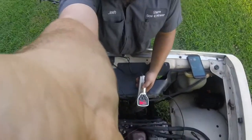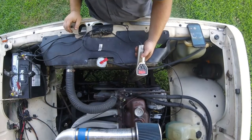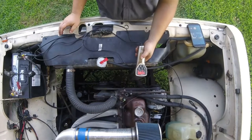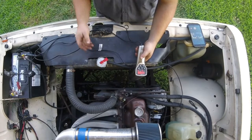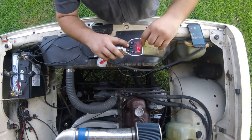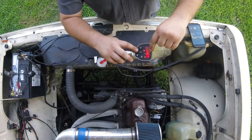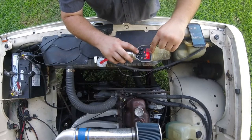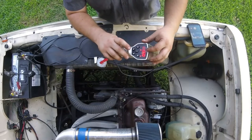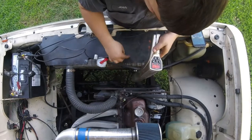It's probably going to be pretty hard to pick up on camera, but there's a white mark on the crank pulley, and it corresponds to about 16 degrees right now on that mark. It goes from 0 to 20 in my case. One thing that's really nice is, say if I wanted to be at 16 degrees — which I do — if you only have a zero mark, what you can do is go ahead and knock the dial up to 16. What that'll do is align that mark on your crank pulley with your zero, or wherever you put it. In this case, it's going to be at zero now, which it is.